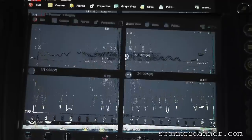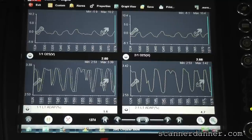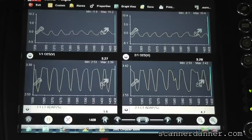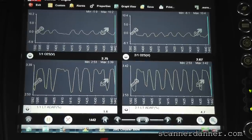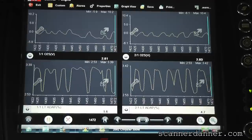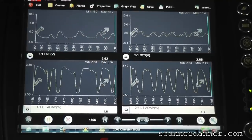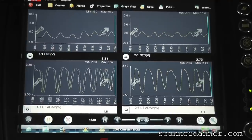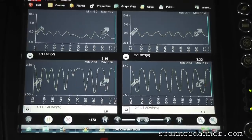Unbelievable that an engine computer was replaced for this. After letting the car run for about ten minutes, the readings look pretty good - short term fuel trim looks great, O2s look great, confirmed fix. You cannot run an aftermarket O2 in this. What we found out is this used to be a Chrysler dealership - they lost that branch of their department and were using non-Chrysler parts. That makes a lot more sense - it wasn't an insurance company demanding cheaper parts. They put NGK plugs in it and a Bosch O2 in it. You can't do that on these cars. That is a fix.